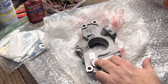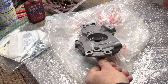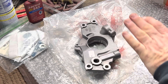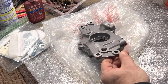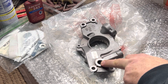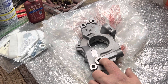What I do is I lay back that angle and make a smooth - what old school porters talk about - waterfall effect. I basically take that ridge out and make a nice smooth transition from the port to the block. I don't make that area from midpoint to the block any bigger; it's all just clean up and making it ergonomically smooth to enter the block.